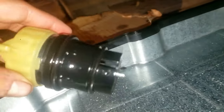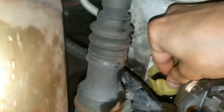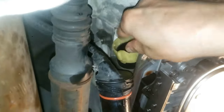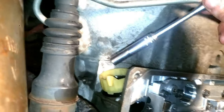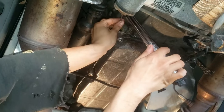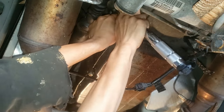Reinstall the new transmission adapter plug, but first lube both O-rings with some transmission oil, then push it in. If having difficulty getting it in, you can tap it with a mallet — details are in the description. Use a 7mm deep socket with a ratchet wrench to tighten it, or use a torque wrench and torque to 22 inch-pounds — not foot-pounds. Once you hear a click, it's secure. Then put in the plug connector and push the lever up — the connector gets sucked in and a tight seal is complete.